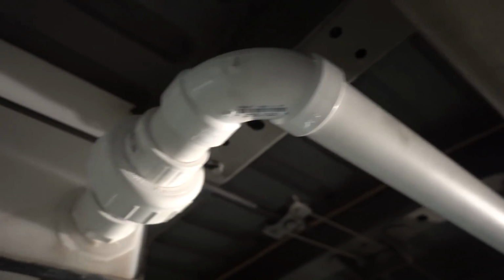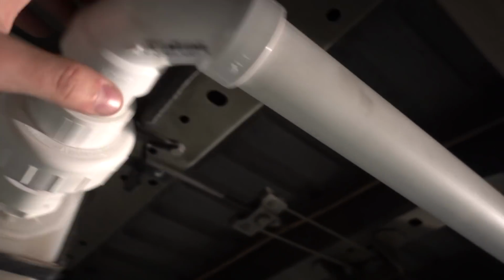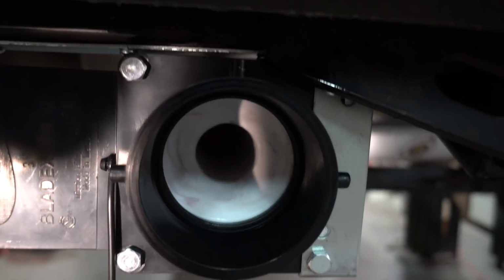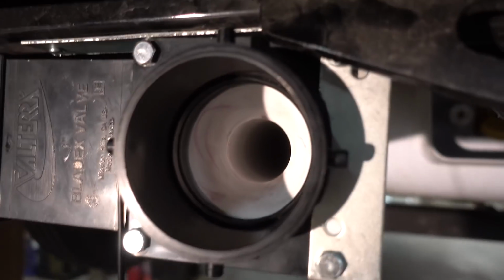And so we had a 1.5 inch line that runs out, it's like a 6-foot run that goes along the exhaust. And then it lands at the rear, and then it drains out there. And so there was my gray water. It's pretty basic when you think about it. It's just running 2 lines meeting together into a tank, out the tank.